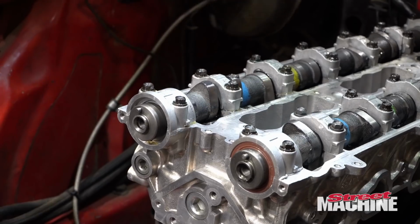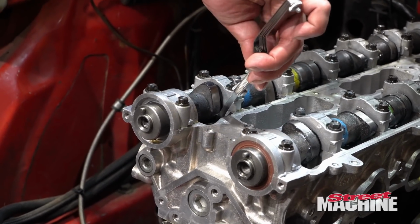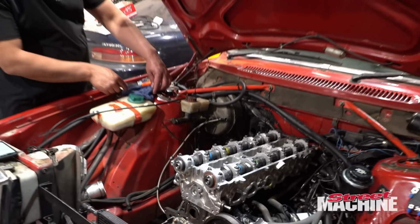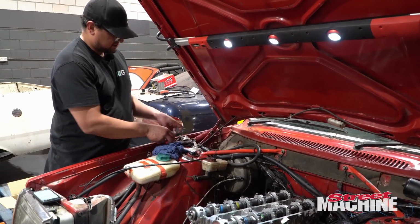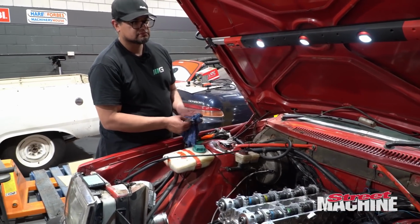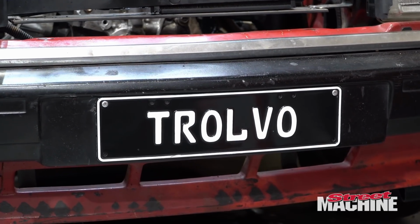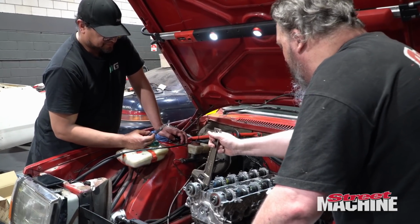Yeah, because 10's loose and 11 is just a little snug. Oh, so it's fine. Yeah, it's fine. Look, we're splitting hairs there. Yeah. Alright, just to call it. So if I say 11 thou for both, we're happy? Number 3. Yeah, keep going. You can, yeah.